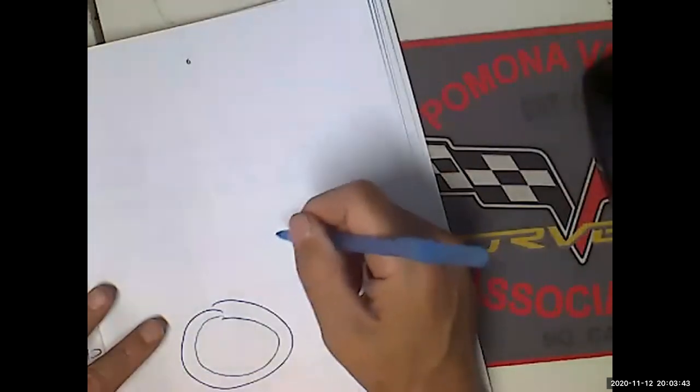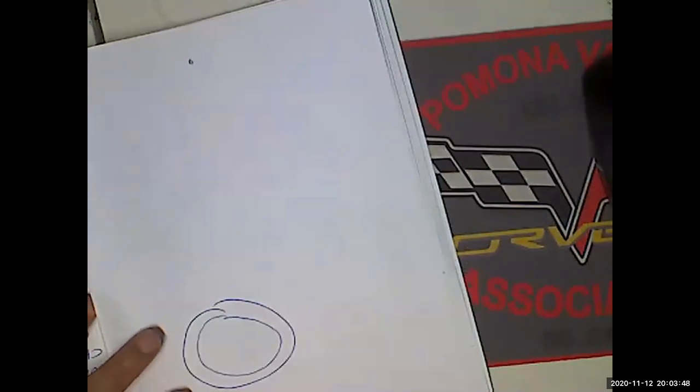All right. So that right there is that one. Inspect, replace, and adjust drive belts, tensioners, and pulleys. Okay. Let's make a drawing. Right here's a crank pulley. This is going to be simplified, folks. A pulley is used any place you have a belt. Engines these days are going to have what's called serpentine belts, which means one belt that drives all the accessories, or almost all of them.